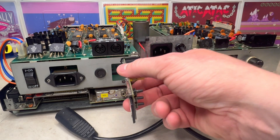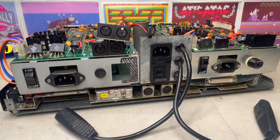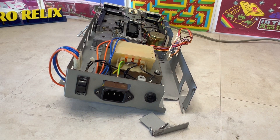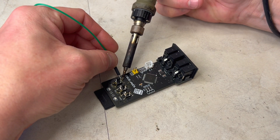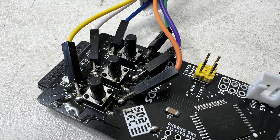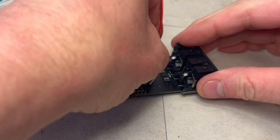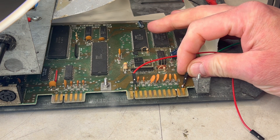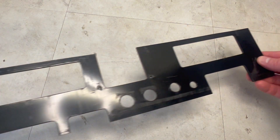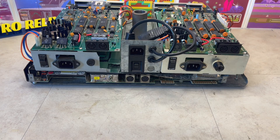This is an SD to IEC. Having modified the rear of this internal floppy disk, we're going to use this to install an internal solid-state hard drive. Having soldered connections to the internal buttons and 5-volt power requirements, it was now time to install the rear panel onto the back of the CompuCase.